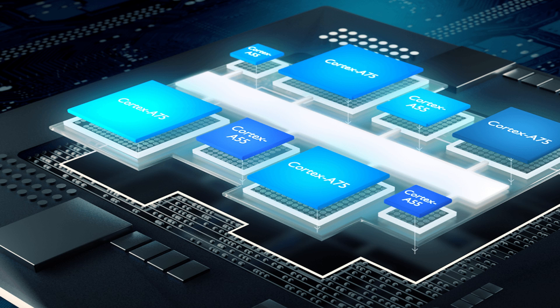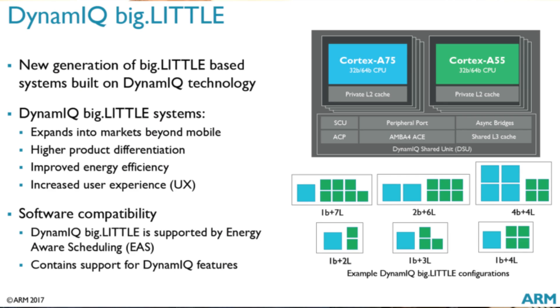You're probably wondering how this benefits us, the customer — how does this get us more efficiency? Well, the big cores offer a lot of performance, but they take up much more space in the silicon and drain more battery. While the small cores are really used around 90% of the time for your basic things like opening and closing apps, RAM management, browsing, and even video playing — all done on the small cores.